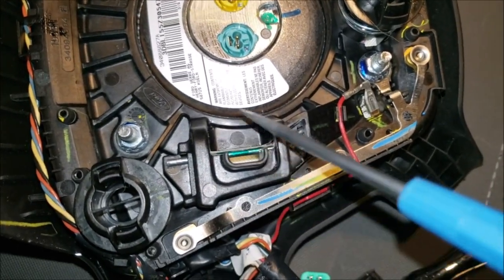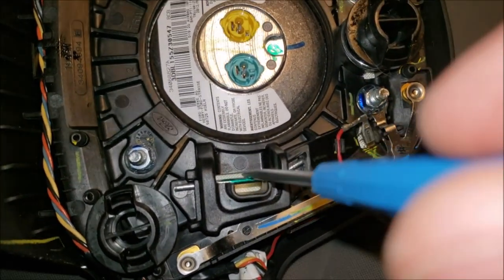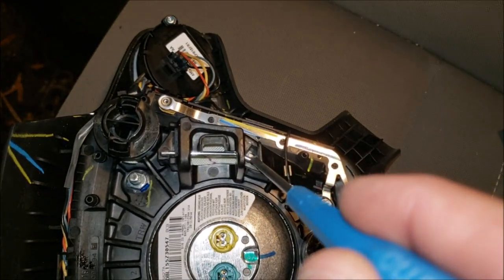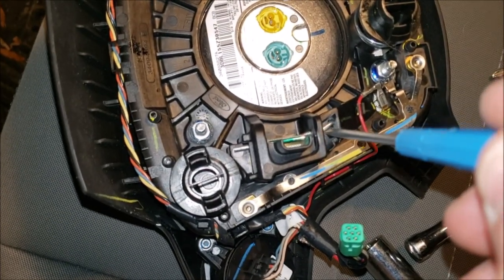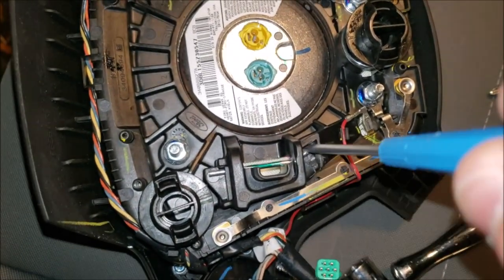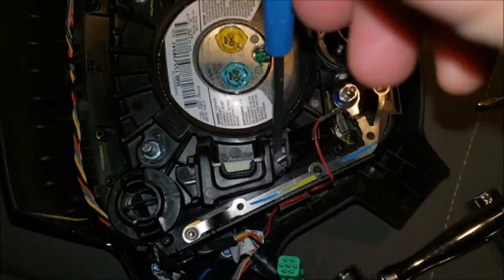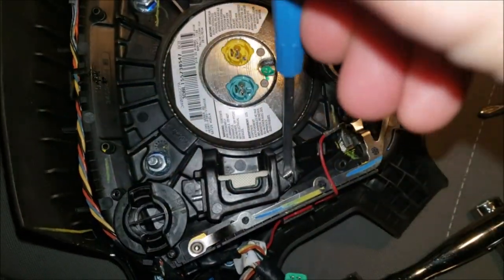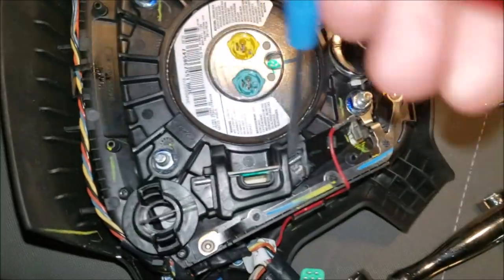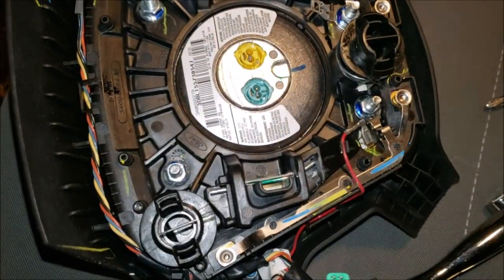This is the back of the airbag, and here is where the hook comes around. You have one pin here and one here. Each of these holes is where you put the screwdriver in through the back of the steering wheel column. When you push your screwdriver in and move it down, you move the pin away from the hook — that's the motion you're going for. It's kind of blind when you're doing it, but you're trying to pry the pin down so it comes away and around from the hook to release your airbag.